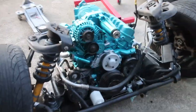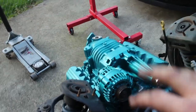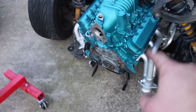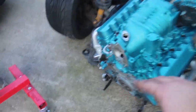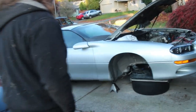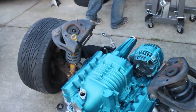Just off the top of my head, things that we still need to do: we still need to put the gasket between the supercharger and bolt it down, we still need to make the flange for it, but now that we have this on we can put it in the Camaro and mock up exactly what we need. We need to get the flywheel and clutch on, get the transmission on, and then once we figure out the intake elbow, that's really it — injectors, and then the other tiny things like the methanol injection and battery relocation. Then we have to bleed the brakes, get an oil change, transmission fluid, and find and reconnect any and all plugs.